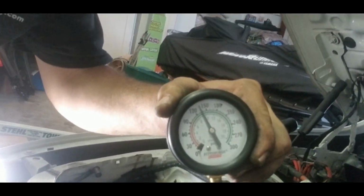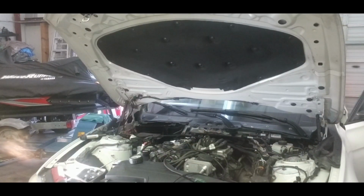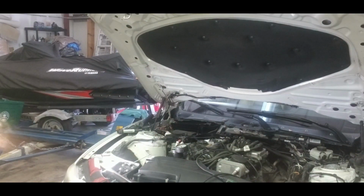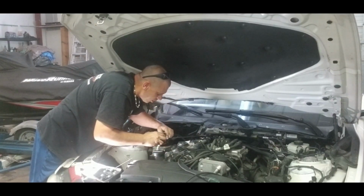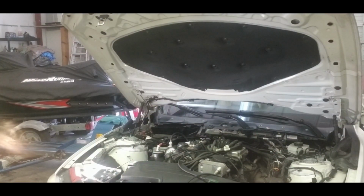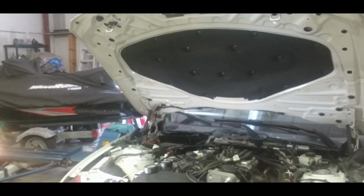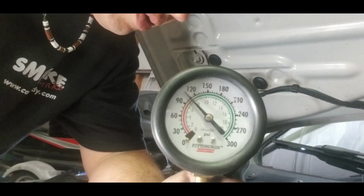See this? Okay. How much is that? Okay. That's 130. Okay. So let's send the number 4. It's almost 140. Check one more time the cylinder number 2. See this? It's all about the 100. So there's a surprise because the computer said it's cylinder number 3.